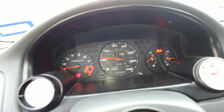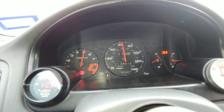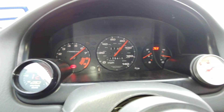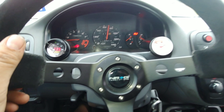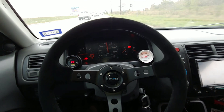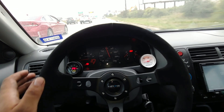Just with that 10% it's a lot better. I think the leanest I saw it get was 12.2 — it wasn't 11 for the most part. So I went ahead and threw in an extra 10%, hopefully to get it a little bit lower than 11. It does seem to pull smoother — it likes the extra fuel. It feels like a stronger pull to me, and it does feel like it's running better.